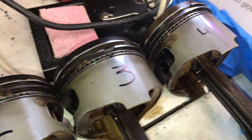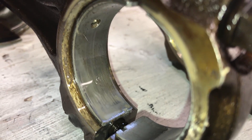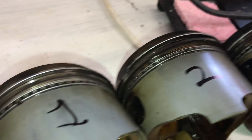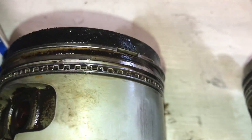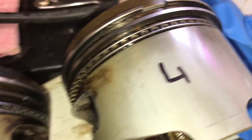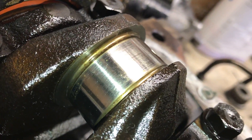All right, these are all four pistons removed from the block. As you can see, the bearings are actually not too bad. That one's got a minor score, but it looks like all the bearing material is still there. They have some discoloration as you'd expect, but I've seen far worse. The most surprising thing is these oil control rings are quite free — they're not glued up and gummed into the ring land like you see on a lot of other engines. So this is actually looking pretty healthy. There's the crank, and again all the bearing surfaces look pretty good. If you get that one in the right light you can see a couple of funny marks on it, but I reckon after a polish it should work fine.